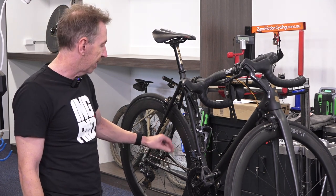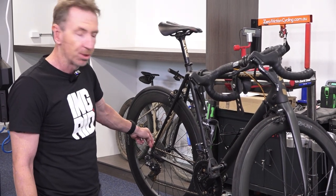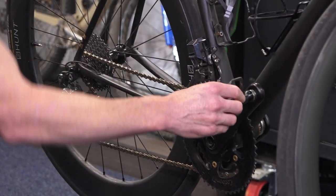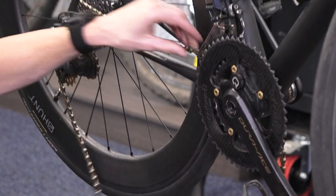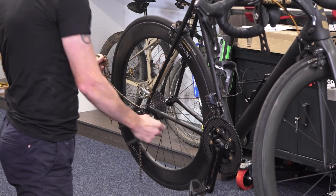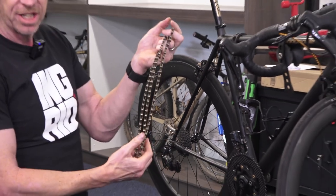So demonstrating immersive waxing. I've got my chain — let's say I'm already waxing or I've bought a pre-prepped wax chain and I need to re-wax it. Step one: put it in the smallest cogs on the rear so there's not a lot of derailleur tension when you release it. Get the master link to the bottom span of the drivetrain. Master link tool — pop that in, squeeze, that pops the master link open. Remove the chain — pull it from the top and out from the derailleur. Keep your master link. I do not wax the master link.